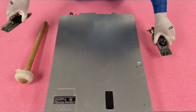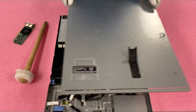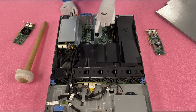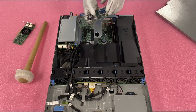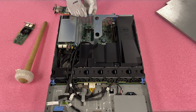I'll show you how to actually install them. Both the options we have right now are low profile. If yours were high profile you'd want to lift the riser up and install them on the riser, but since we have low profile cards we're going to come over here and lift this up, making sure that the blue latch is set to unlock.